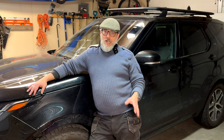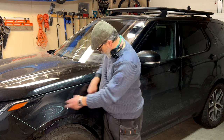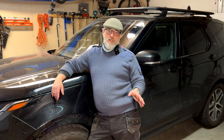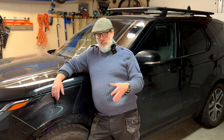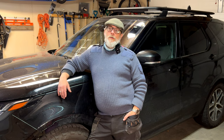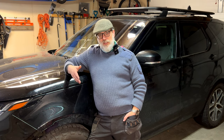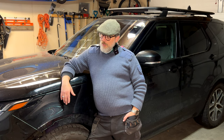But DEF isn't quite as simple as that, because there are problems with using it. Yeah, sure, you load it up and it fits somewhere in here, really. And then the car squirts it into the catalytic converter, but you can only do that with liquid DEF, and it can only do that when the catalytic converter has reached a certain temperature point, which permits this stuff to go on. One of the problems with running these modern day diesels on short journeys is that the car never gets warm, and then this injection system is interrupted or ceases to happen. So that's the first problem.